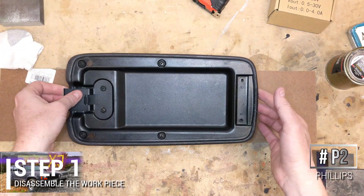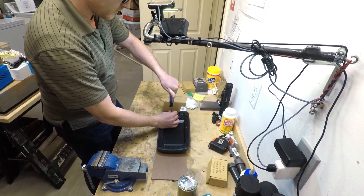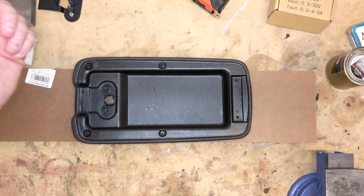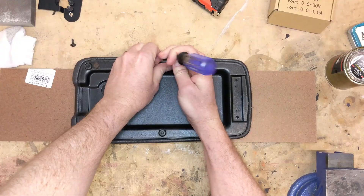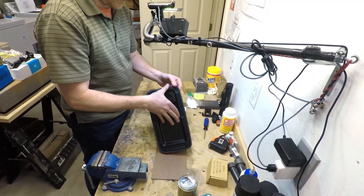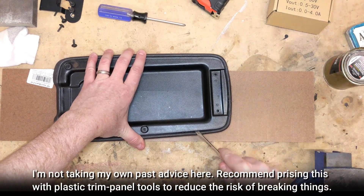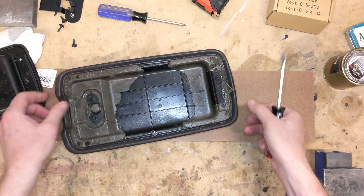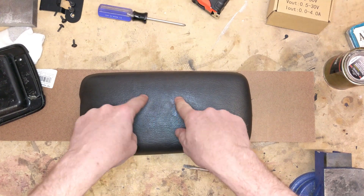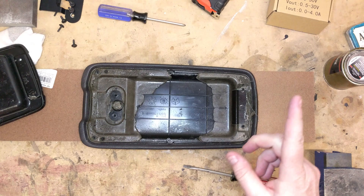This here is the center console cap from my 2000 Jeep Cherokee. I've removed the two screws that hold the hinge in, and this piece just comes off. I'm starting by removing the latch assembly — this is actually an aluminum aftermarket one from JCR Off-Road because the original plastic one was long broken. Once you have those two screws out and the latch piece removed, there are just four more screws to completely disassemble the rest. The plastic piece just pops out away from the gray backing. There's a rubberized backing on here with some compression to it, but not enough to just recover directly with upholstery — I've tried that a couple of different ways and didn't like the results.